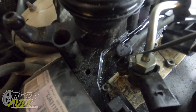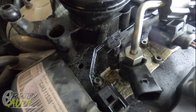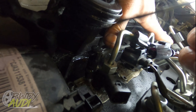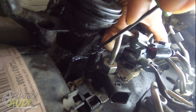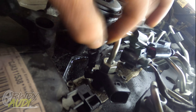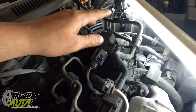There are a few different ways to do these injectors. This is like a fuel return line. What needs to happen is this clip right here stays in place, this one right here is going to come up — so they're all going to look like this right here. What I have found is if you hold this side down and you get a little screwdriver, you can usually clip it just enough that you can get it and it'll come right out just like that. Then you just pull them all off and set that line off to the side.